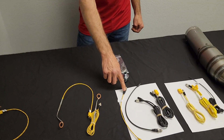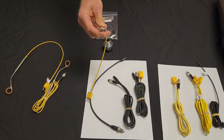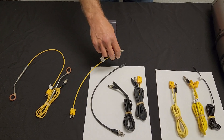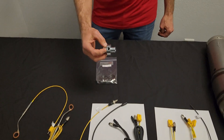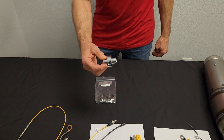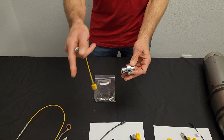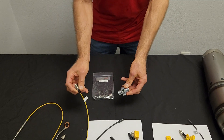And water temp sensors — you can screw these directly into a Rotax or an X30. The Rok engine doesn't have one. Most water-cooled engines you'll need the inline water temp sensor adapter. You just cut your water line right after the head and screw this thing right into it. Piece of cake.